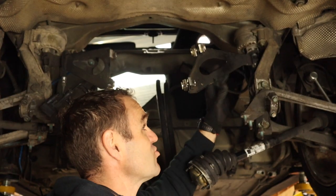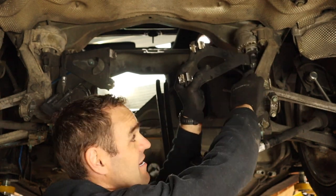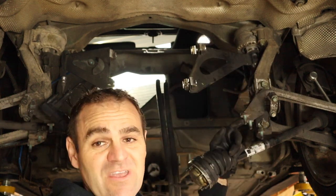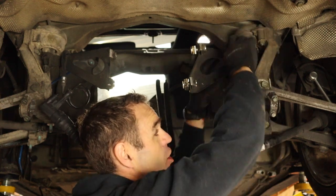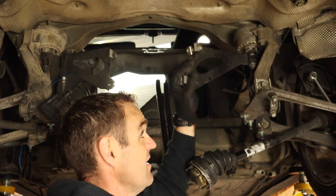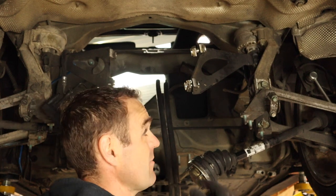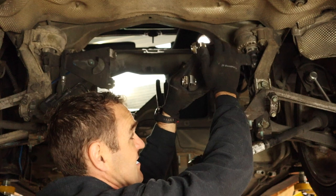I was trying to remove the arm off the bottom of the gearbox mount, and I could not undo this nut while the thing's on here. I should have looked at it, undone the bolts, and taken the whole mount off first to try on the table. As it was, I was pushing against the rubber seal and I've completely trashed this mount. The other one's still reasonably solid, but I'll probably get a couple of new mounts anyway — though that's not my priority at the moment.